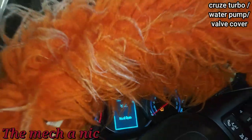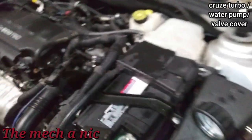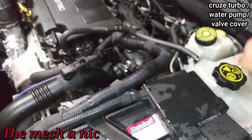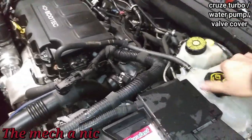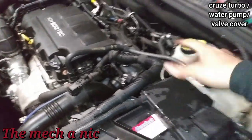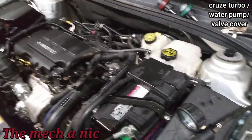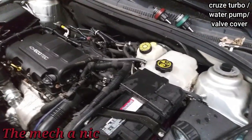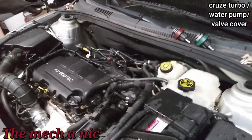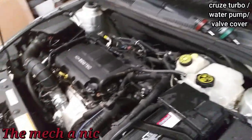Head gasket. Coolant does not shoot up like that every time you hit the accelerator pedal, especially when the engine is cold - it's a head gasket, that's it. No more second guessing myself. I'm putting air in the tires, parking it back on the street. She can get a refund for the labor she paid and that's it - I'm not messing with this turd.